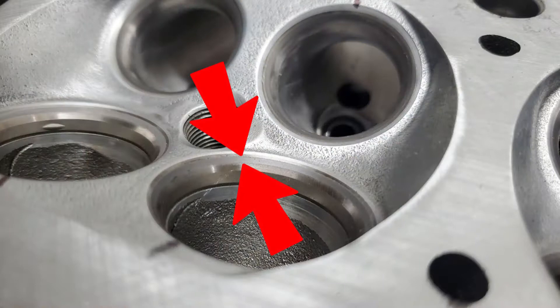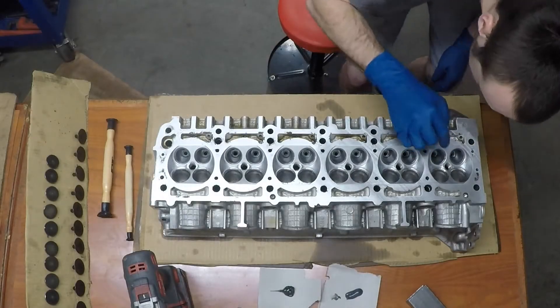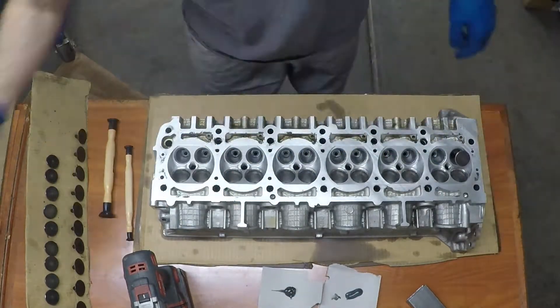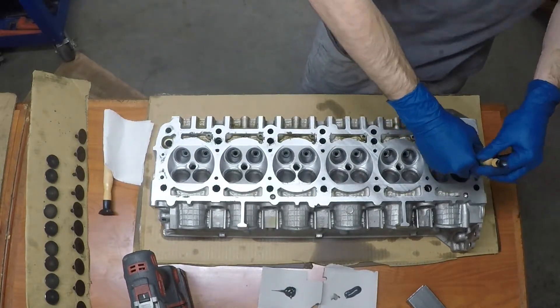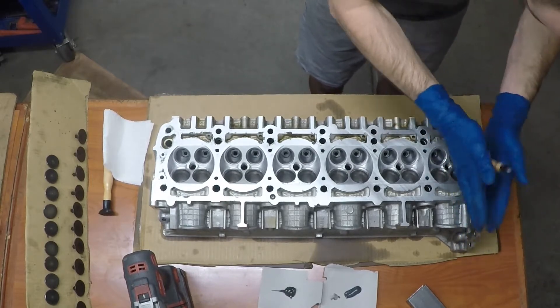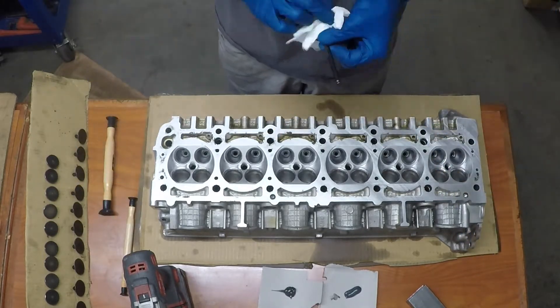Pull the valve out, wipe it off, and check where it seals. Make sure there is a nice gray ring that goes all the way around with no breaks — no way for combustion to leak past the valve. Also check in the cylinder head where the valve seats to make sure there's also a gray ring there with no breaks, confirming it's going to seal perfectly. As long as there are good thick gray rings on each one, you can go on to the next valve. Remember not to mix up these valves — once you lap them into each port, that is their home. Each valve is home to one port and one port only, so it's critical to keep them organized.